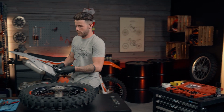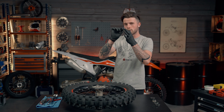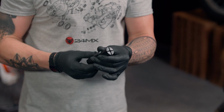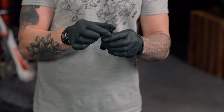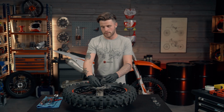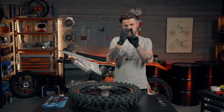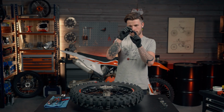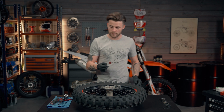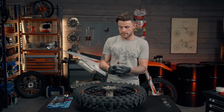like so. So firstly, as you can see on the die, it's separated into 4 quarters. What that does is, as you tighten the die up, the ends will open up, which will then hold the bearing. So when the die is in place and we have the slide hammer knocking the bearing out, this little rigid edge will hold the bearing the other side so it won't slide back through. So what we're going to do, the first step, is we're going to slacken off the die so we've got a lot of movement on this end.